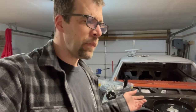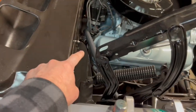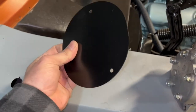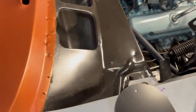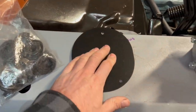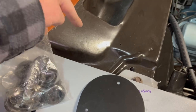I've got an idea — I've done this on other cars — we're going to go through the vent just below the windshield. Here's the dash, here's the cowling, and there's a factory vent on the inside right here that goes all the way down into the passenger compartment. There's a plate that comes in the Vintage Air kit, and what we're going to do is put a hole here and a hole here and use their rubber grommets — which are already included in the kit — to stab the hoses through so it's sealed and tidy. That saves a few bucks, and this is how we'll get all four lines — hot and cold — inside the passenger compartment.